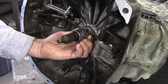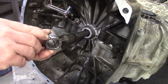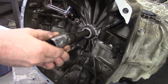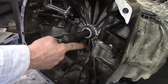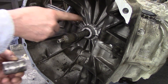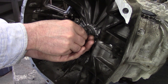So we're going to try to do a repair here. What I'm going to do is weld the two halves together for about a half an inch on the end here so that it gives it more rigidity. Then I'm going to stand this transmission up on end and fill the lower section with water so that the seal in there does not get burned up. I'm going to bevel this edge and weld this back in place.